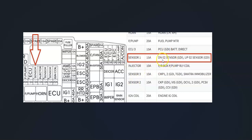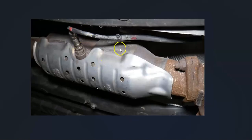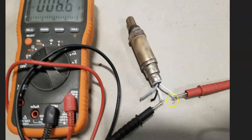Also keep in mind that these sensors are on a fuse — the downstream O2 sensor and upstream O2 sensor are on sensor fuse 1, and if that fuse were blown it could cause issues. Sometimes these are also on a relay. So if you've gone through and the wiring looks good with no blown fuses, the next step is to test or replace the O2 sensors.